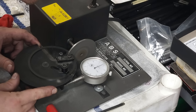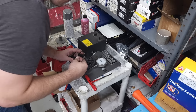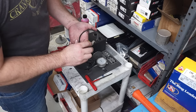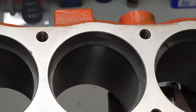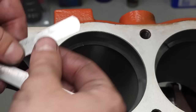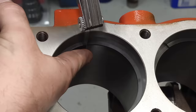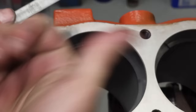Once you've completed taking off material on the machine, remove the ring and then, using a very fine file, take off any micro-burrs that may still be on there. Place the ring back in the block using a ring setter and use your feeler gauges to determine the gap in the rings. We're aiming for a minimum of 17 thousandths. Perfect — nailed it.